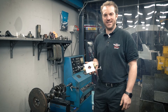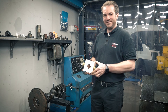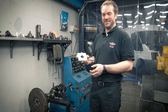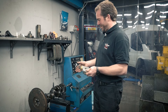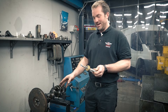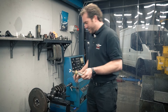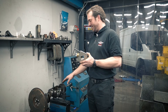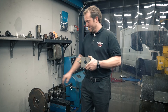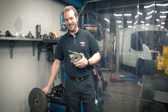So now we've finished our calculations — these are our bob weights. We made these ourselves in-house, so they're very accurate. I spent a very long time measuring every single component, making sure they're all exactly the same weight as each other so everything's interchangeable. Because this is not a 90 degree crank, we've got to have six bob weights for it, because it doesn't share the same big end journals. So what I'm going to do next is carefully put all of these onto the crankshaft — they've got to be completely flat, in line and perpendicular to the position of the journal.